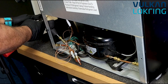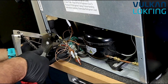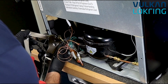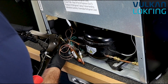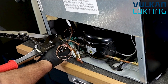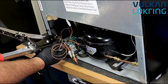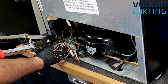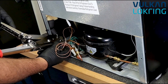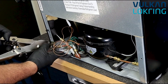You'll want the fixed handle of the tool opposite the fixed object in the cabinet — in this case, the heat loop. So Charlie flips the tool over, takes his fixed hand, and grabs the dryer to ensure that everything maintains against the center stop during the compression phase. He goes ahead and closes the connector. Once both rings have contacted the center stop, assembly is complete.